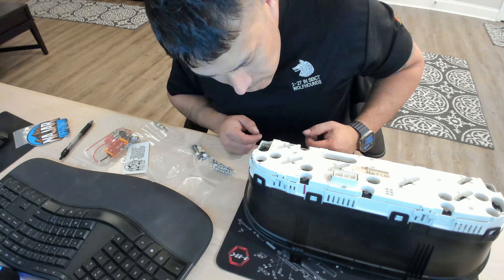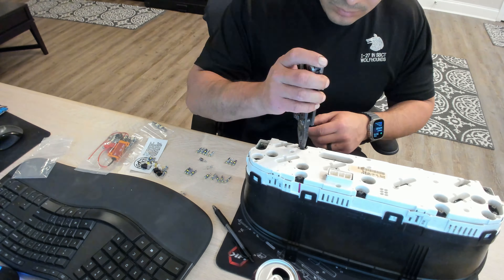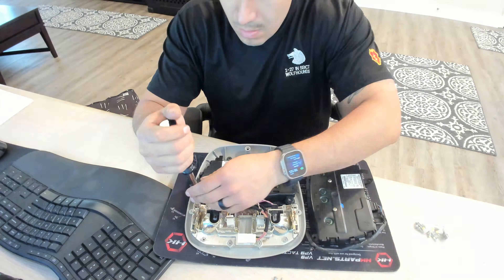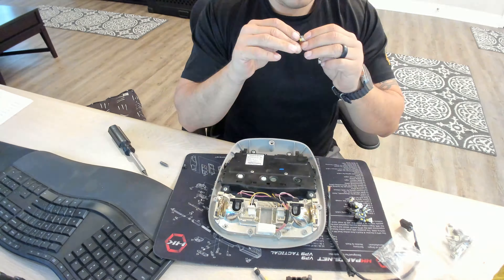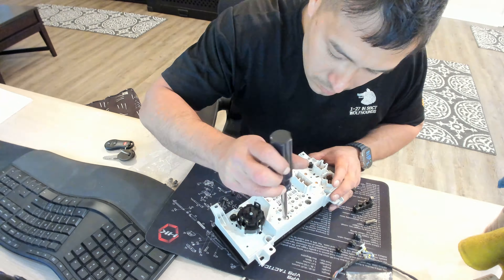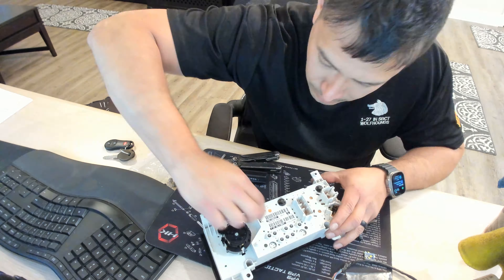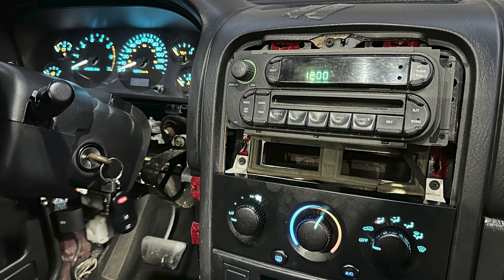This last little bit of the video is just a run-through of me swapping the dash lights to LED in the gauge cluster, EVIC module, and HVAC module. I followed Najaroff Road's DIY, but some units may vary, and I ended up having to test it and found some lights which were incorrectly polarized. The light adapters were also a little undersized or oversized depending on the application. Overall I feel like the LED upgrade is a must-have for clear and easy-to-read gauges, and they're not expensive at all, so it's definitely worth it.